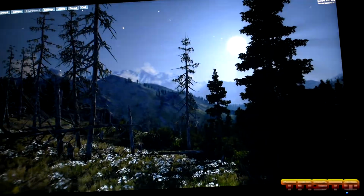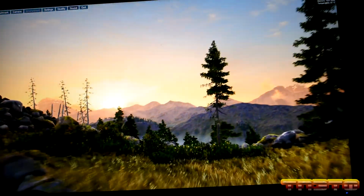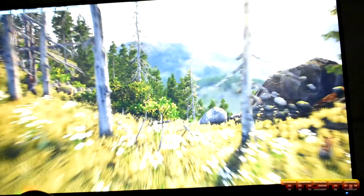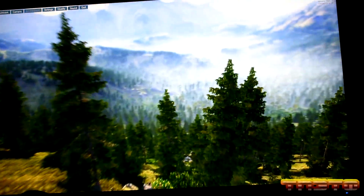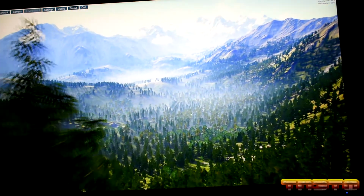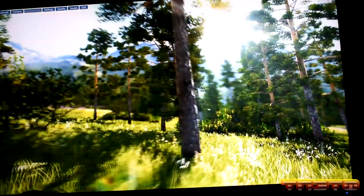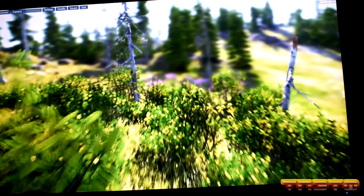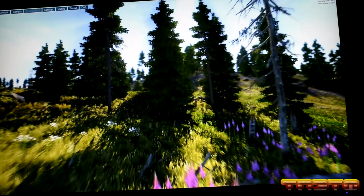Oh, we're not too bad. Our FPS is averaging like 150. Oh, it bumped up there. It's hitting 200s. So our graphics says 2100 megahertz, and our memory says 7001 megahertz. Our temperature on our GPU is 62 degrees Celsius. So, yeah, it's averaging like 170, so that's not bad at all. And those little quirks, that's just how the benchmark is. It does that on like every computer. Yeah, it says like it's 160, 170 range.